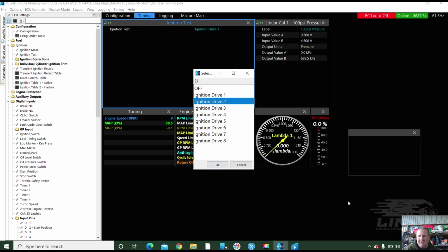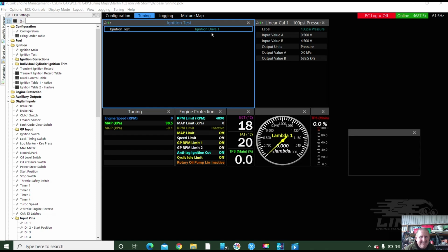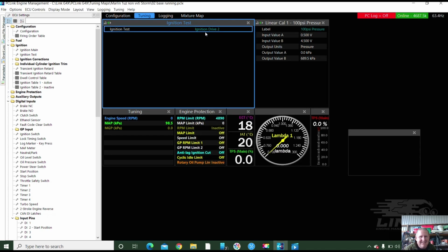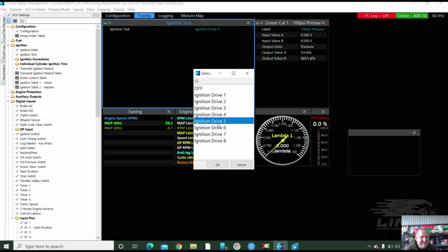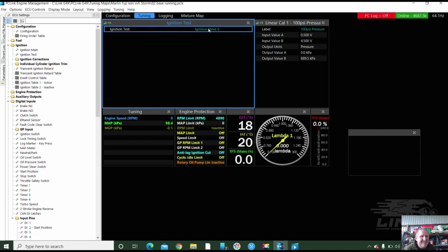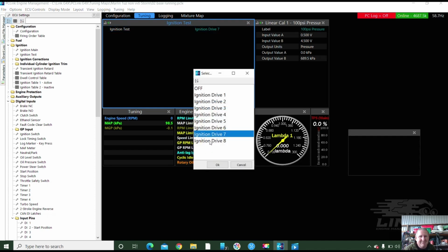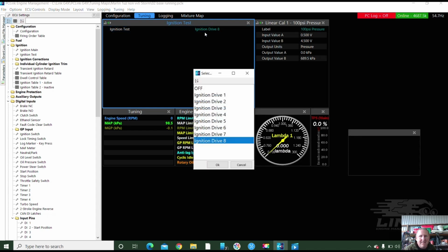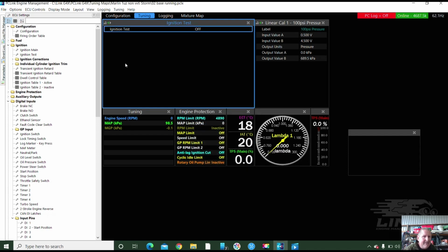I actually have a tester. Coming. There you go. Yep, that's right. You can feel that positive. You want 3? 4. Here comes 4. Yep, that's working. I can't hear that one at all. I can feel it. 5. Yep, I can feel it. 6. Yeah, I can hear that one now. Makes a big difference when those valves are open to them ticking. 7. Yep. 8. Yep. Done. Okay, and then we do some injectors.